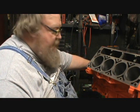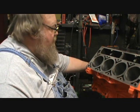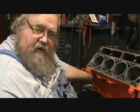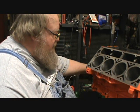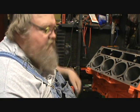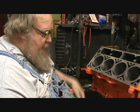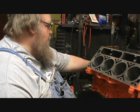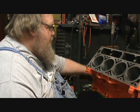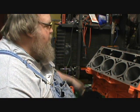And I'm really happy with that crank. There's very, very little resistance on that crank. And no, I did not check the actual clearances. We just polished it. We're putting them back together. This is one of those cheaper builds. Somebody wants something cheap? Here's your cheap version. I know everything's okay because he mic'd it, and he's like, it's been a while since he's seen a crank this good. And I'm like, well, that's good. And we put in the good King bearings. Is what I'm putting in this.